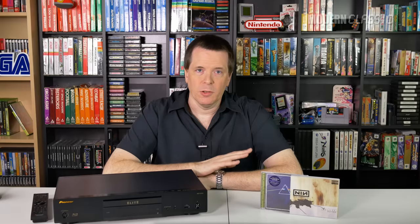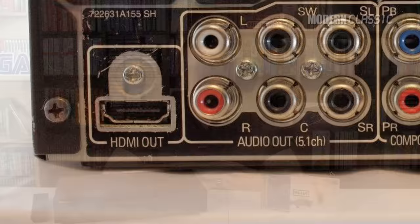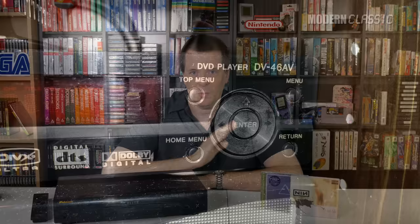These are players made to play either DVDs or Blu-ray discs, plus CDs and SACDs. I learned that you cannot use an optical output to listen to SACDs — your player needs to have HDMI because it needs an encrypted signal. But not every player with HDMI will output SACDs over it. I ordered a Pioneer DV-48AV, which I'd confirmed in its manual would do everything I wanted. I received instead a DV-46AV, which is exactly the same player except that it will not output SACDs over HDMI. So that player went back.